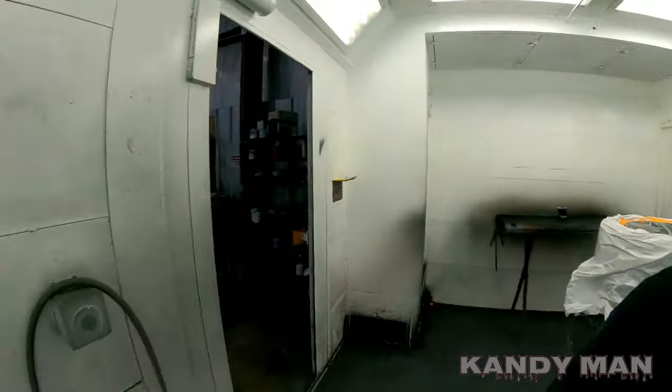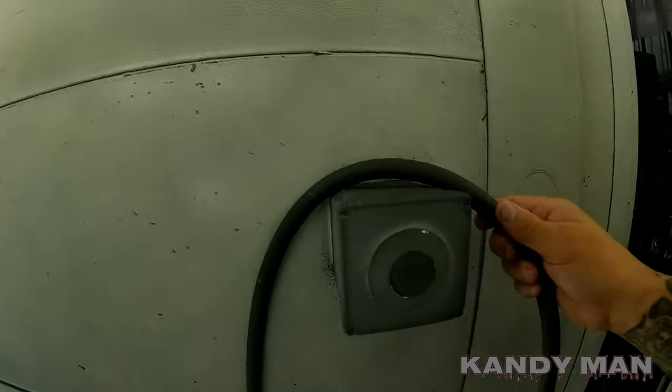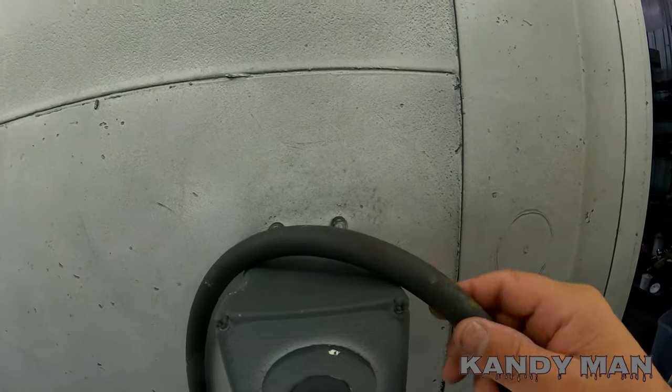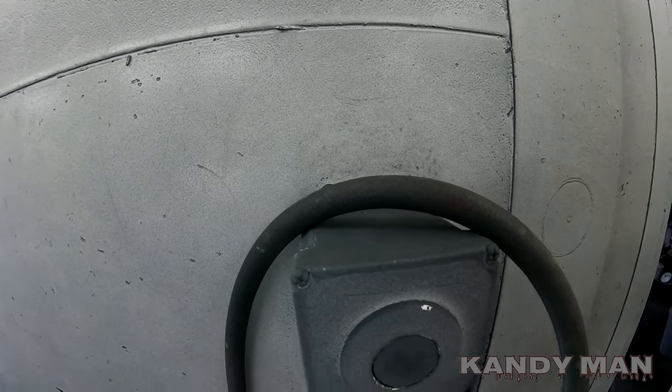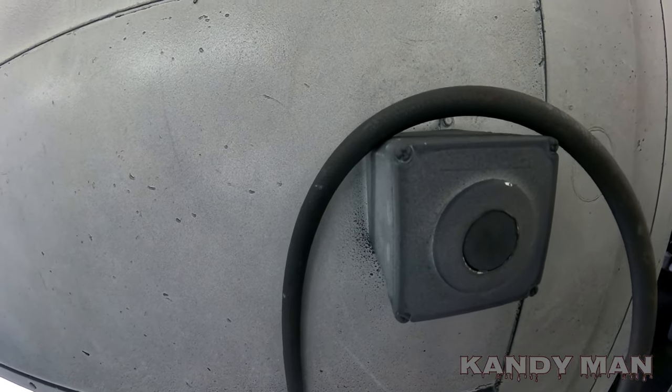So I was telling you guys about different things I deal with sometimes. Sometimes you can actually get a problem with your air hose. You know, we bake these cars at 140-150 degrees to get the paint to dry. So sometimes this hose will deteriorate over time. Mine's pretty old now. This has got all overspray on it. But this thing will deteriorate over time and actually break loose and spit little rubber through the line. And that'll cause you some fisheye problems and different contaminant problems because of that hose being rubber.